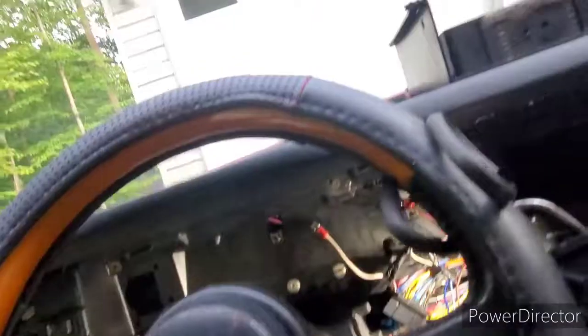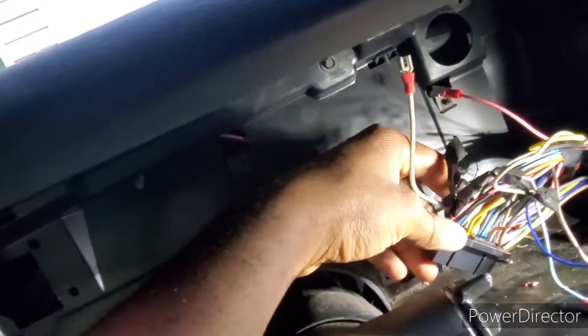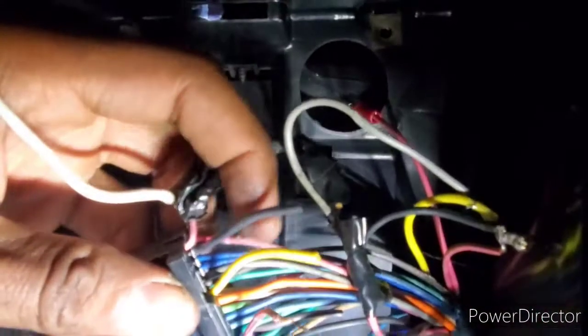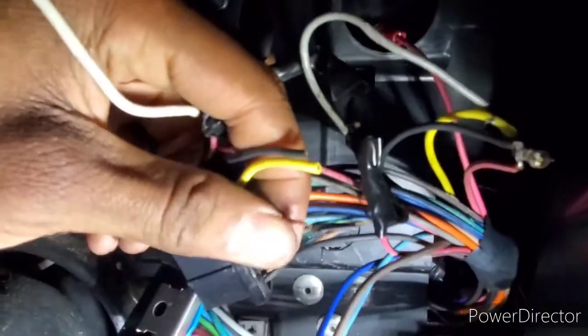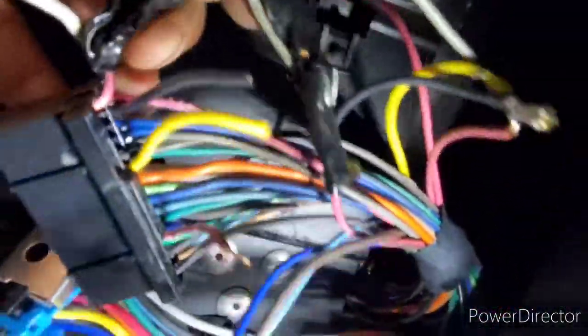This is a little confusing — you have to hook up C15 to D11, then to D3. C15 is on the left side, that's the gray wire. D11 is on the right side, that's the yellow wire. After you hook that up, you gotta connect it to D3, which is the pink and black wire. This one is already cut, so I'll use the one from the main harness.